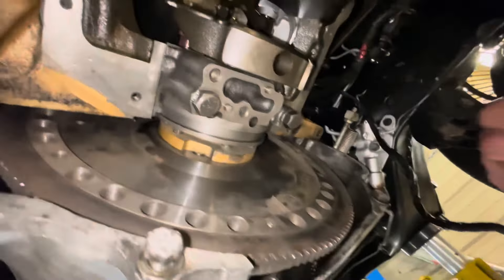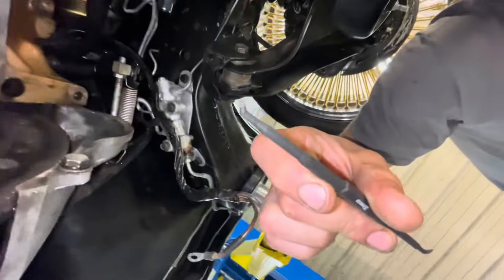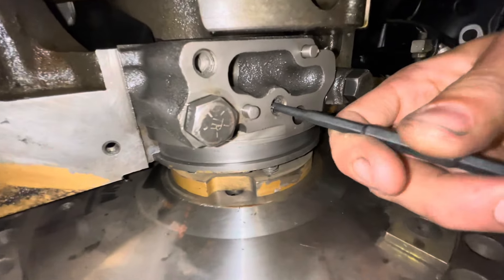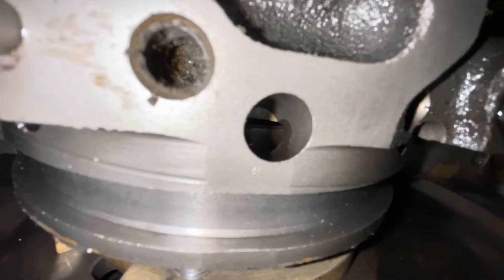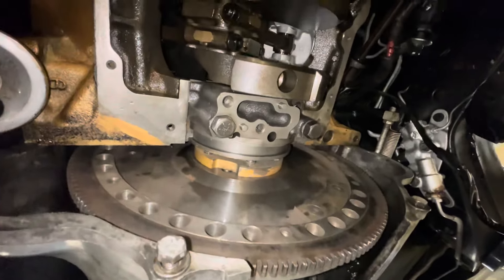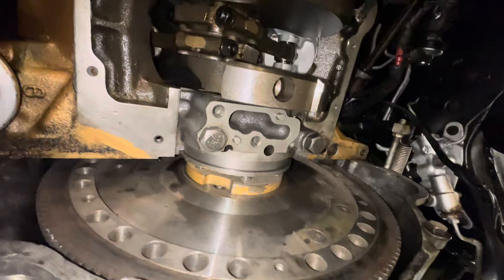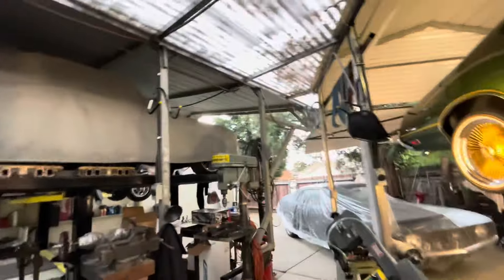Andrew, what are you going to show me? There's sand in this bolt hole for the oil pump — you can see it, just a little bit came out but there's more in it. Yeah, it looks like sand. It looks like when they built the motor — maybe when they bead-blasted the block they didn't clean it out. Hopefully it's a blind hole and we can just clean it out. Also sounds like it's hailing outside.